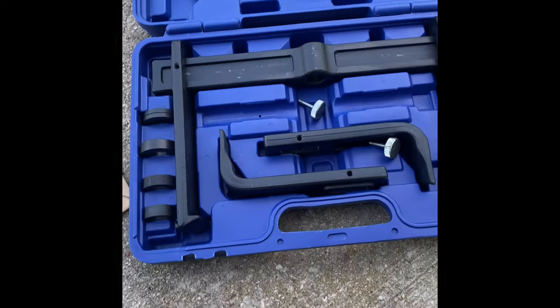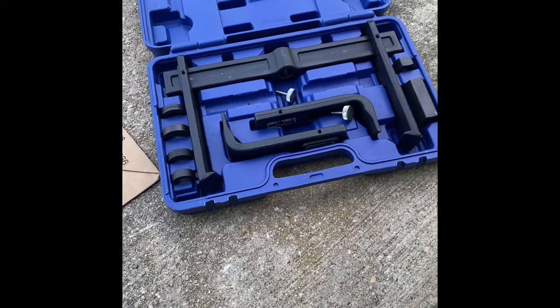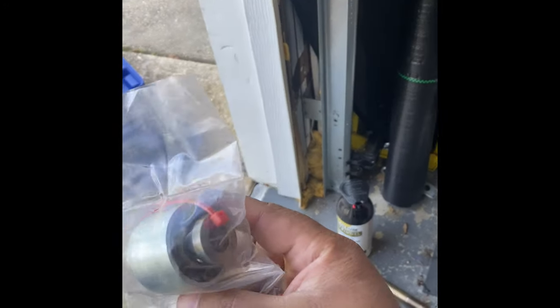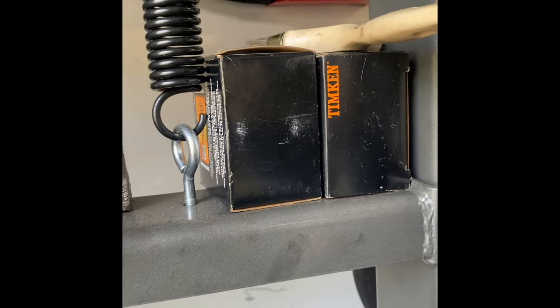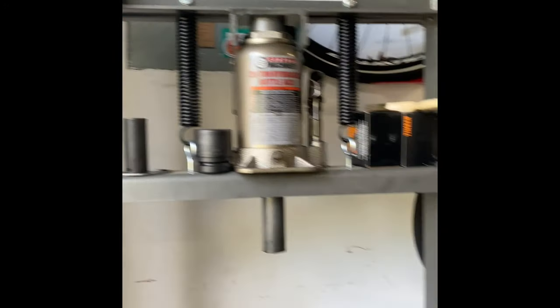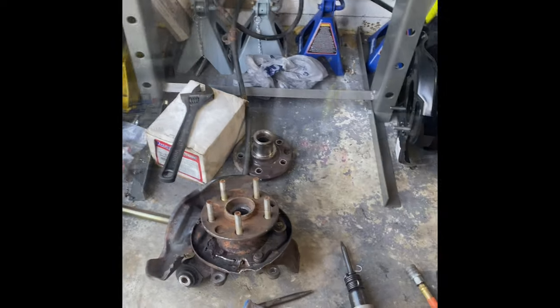You're going to need some tools. This here, I'll put in the description what tool this is. This is going to help you rip apart the knuckle assembly. We're going to install a set of spherical bearings for the bottom bushing. We're going to replace that. And we got a set of brand new Timken bearings we're putting in. And I'm going to show you how to get this done real quick in a 20-ton Harbor Freight press. All right? So, here we go, guys.